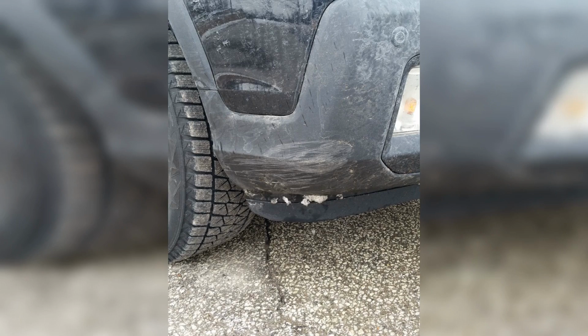4. Polish using the drill's polishing head at 1200 rpm. Polish the surface until it is slightly cloudy. Finish with polishing paste. Use a microfiber cloth when polishing your car.